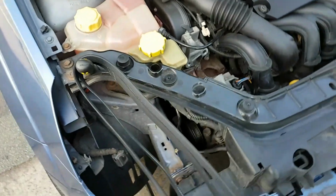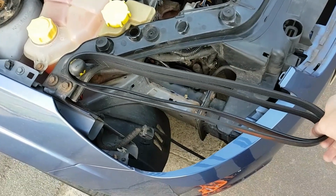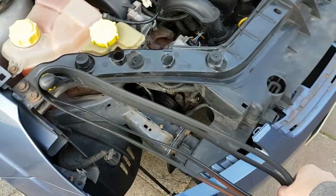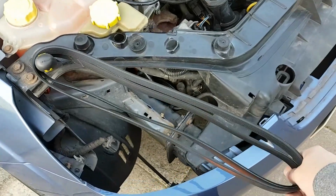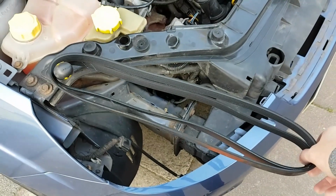Just going to check that these are 100% the right size. As you can see, the top one, which is looser, that's the old one. The one below it is a bit tighter. And these are the stretch fits, so just remember that. So it should be a tiny bit smaller. These two definitely line up quite well, so definitely the right one.